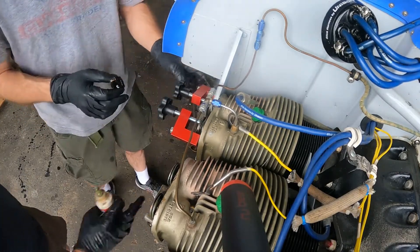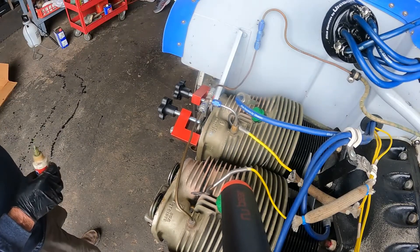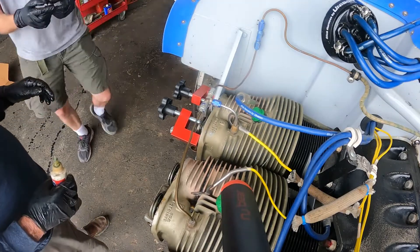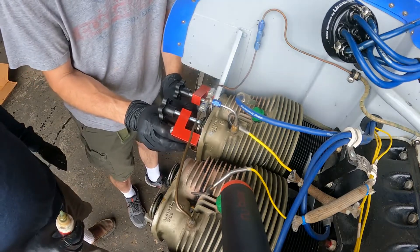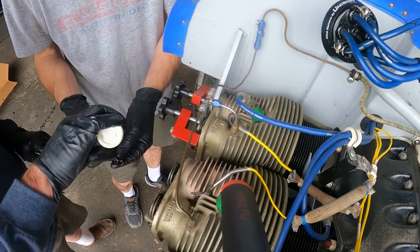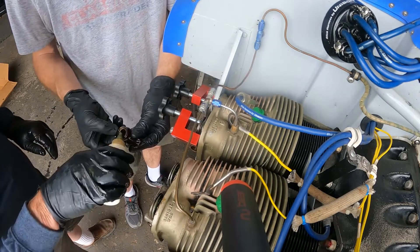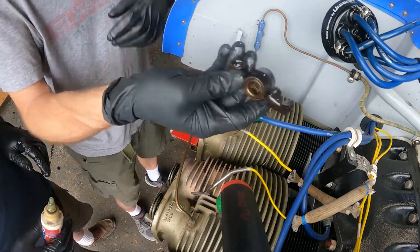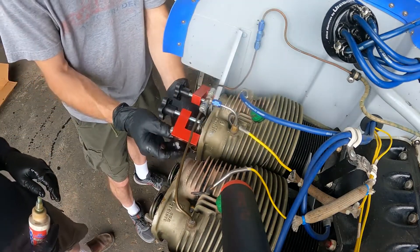So the exhaust... where's the exhaust pipe? We're going to do intake first. Let's go — because I just got it in there. Pull it out for a second — would you like to lube it? Lube it in the cup. We just put a little bit of lube here in the cup that catches the pushrod, so that way it goes in there smoothly.